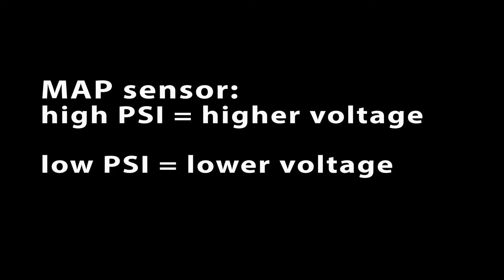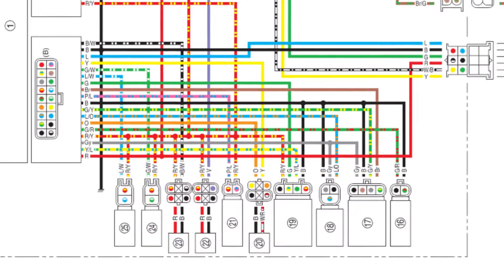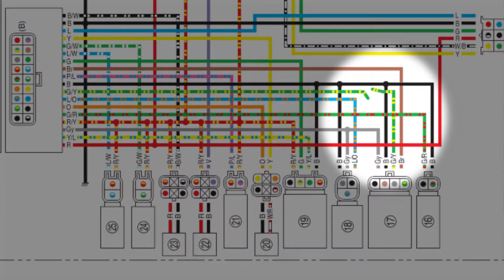The normal range for voltage from the MAP sensor is 0.6 to 4.8 volts DC. A quick way to remember how the MAP sensor works: high pressure equals high voltage, low pressure equals lower voltage. If the voltage falls below 0.5 volts DC, the ECU will trigger error code P0107. Possible causes would be an open power wire or an open signal wire between the MAP sensor and the ECU, the signal wire shorted to ground, the signal wire shorted to another wire in the harness that might provide a path to ground, or an open ground wire between the sensor and the parallel junction.